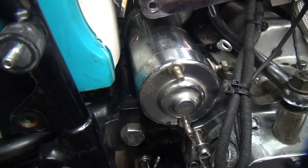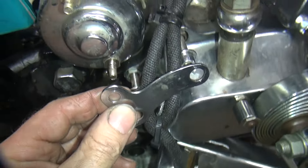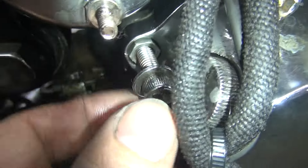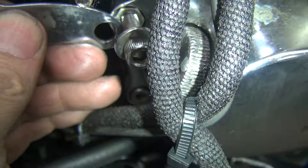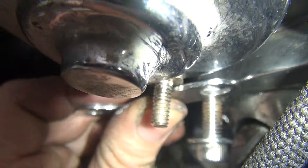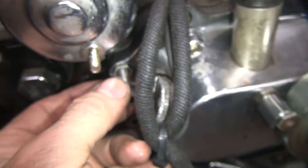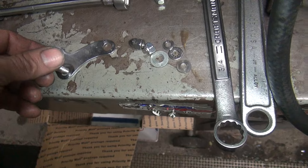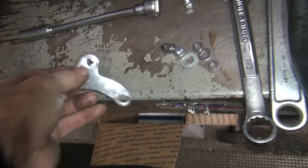I got the starter motor bolting in. The next problem is putting our support bracket across these two bolt holes. The issue is we've got this aftermarket heavy-duty kicker cover on here which takes allen bolts. So what we do is put a nut inside where the allen bolt would go — that allows you to put the bracket on and tighten it up correctly without it just buckling inside the hole. We also need to make sure we have the right offset so the bracket sits square.